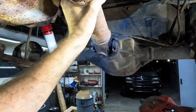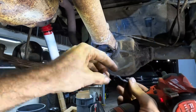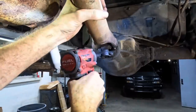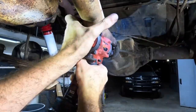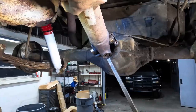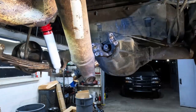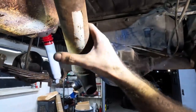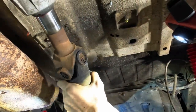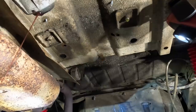Taking care to not lose this stuff. Put that up on the lift arm — should be safe there. A little pry bar action. Good thing we're getting into this rear end — I think this pinion seal is leaking. A lot of grease there. Alright, shaft coming out. Yeah, it's not dry. I've got a little pan down below so whatever spills will get caught in that. We'll set the shaft aside — we'll need that later.